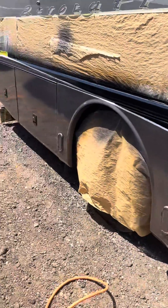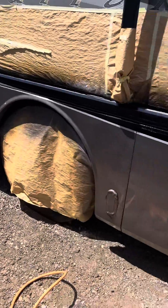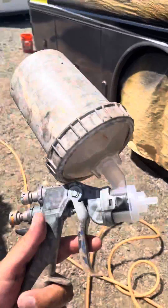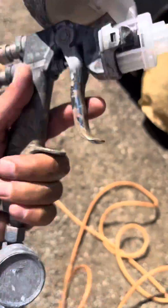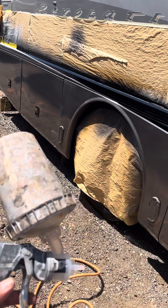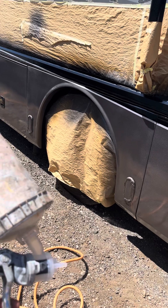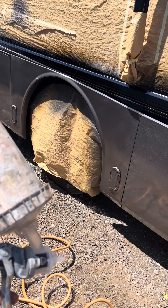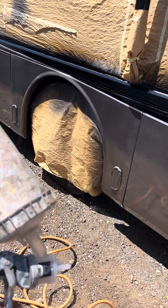So many people are interested in my video about how to spray outside and how to leave it so clean without getting dust on the vehicle. I told them there are a couple other things I have to mention, so I'll go over it again. First of all, my pressure is set at 20 PSI. I do go a little higher sometimes. The clear coat is mixed 50% reduced.